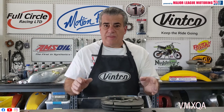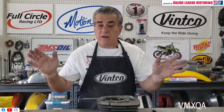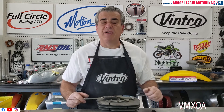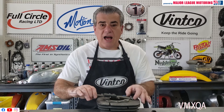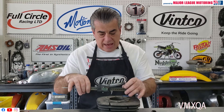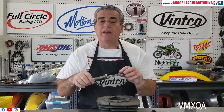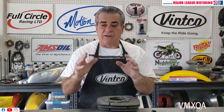Here's the important thing. You want to first try to confirm that your cylinder is actually on its stock bore — it may not be, so go look up what the specs are on your bike. This happens to be a 1974 CR250 Honda cylinder. The stock bore is 70 millimeters. I take a digital caliper, and from the top directly across, I take a measurement. It happened to read 70 millimeters. But now I want to check the rest of the way down to see if the bore has wallowed over the years.